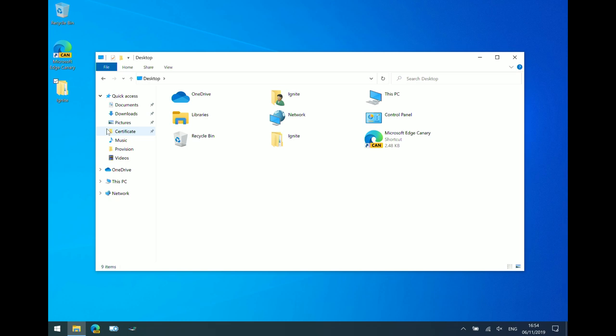So remember what we did to do the recovery process? We had volume down. Volume down is the one that's further from the power button. So we held the volume down button and we turned the device on. I'm going to turn off the device again here. In 5, 4, 3, 2, 1. Please. Okay. Or I can just yank it off the electricity if I want, right?